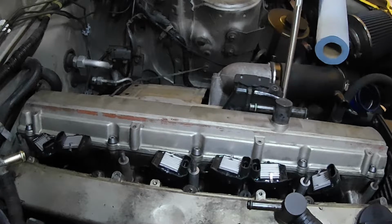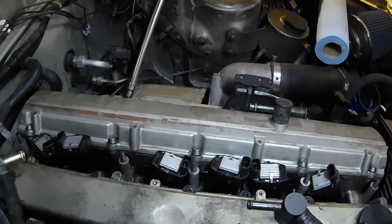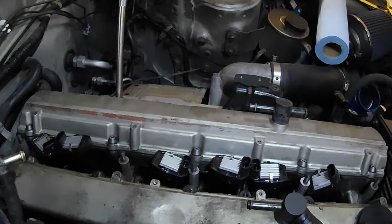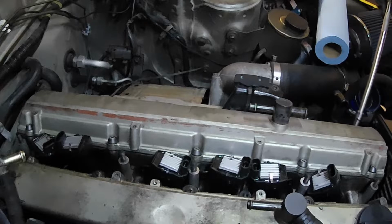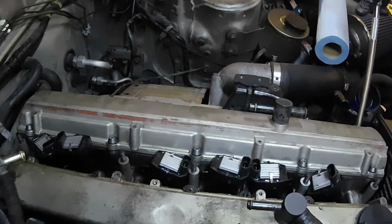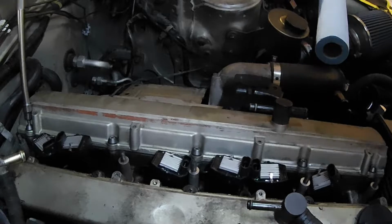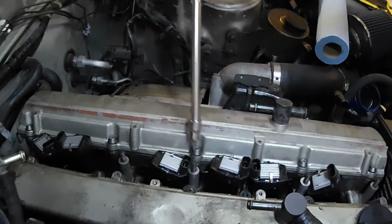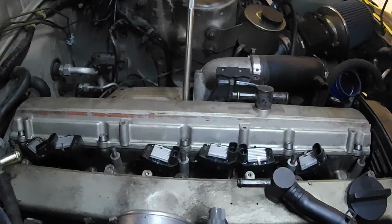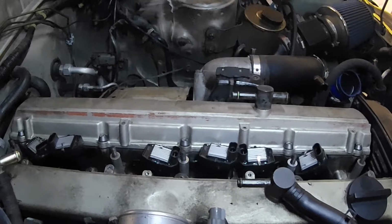For reference, a typical wheel install is about 80 foot-pounds. So I wouldn't expect you to have super high torque for this, but I did find it interesting that it's very, very low. Alright, so number 9 and number 10. Okay, yeah, we're just going to give a little extra oomph on these, just to drive home the 3 foot-pounds. Like I said, it's 1, 2, 3, 4, 5, 6, 7, 8, 9, 10 is the sequence.